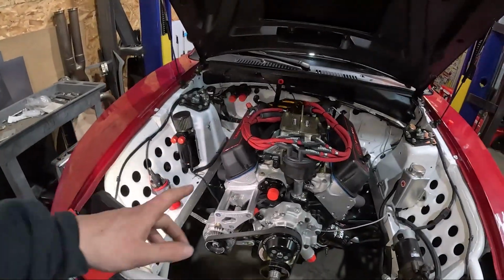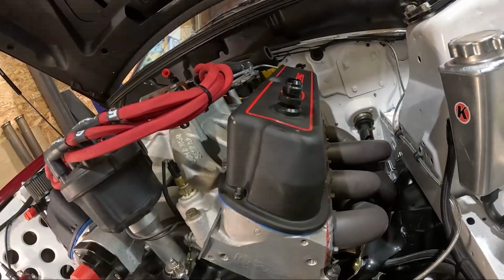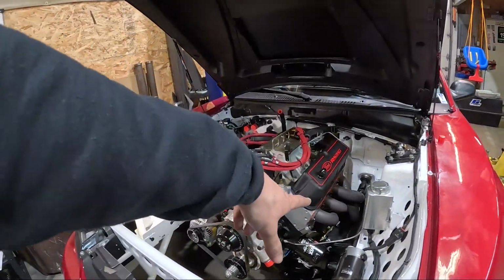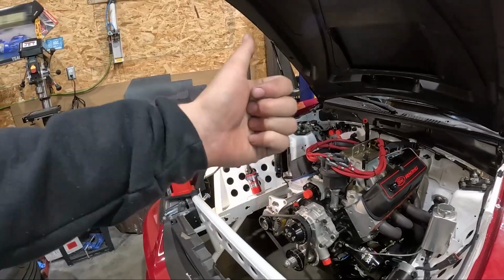All right, you guys, so been out here today, haven't been filming, but Uncle Steve came over and we got the motor put back together. Valve train back in, got the valves all set and everything. We checked spring pressure, everything was good. And we borescoped the cylinders to check everything out, make sure there was nothing to get excited about. And we also replaced and put in new spark plugs. So motor is serviced, ready to go.